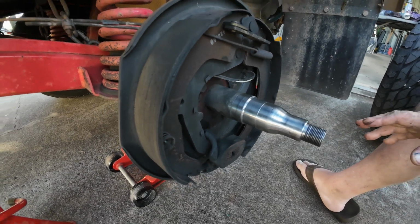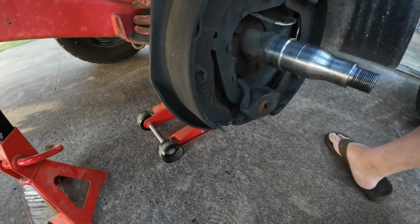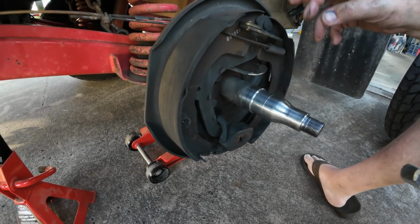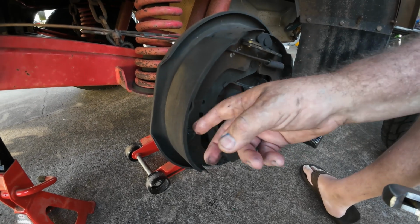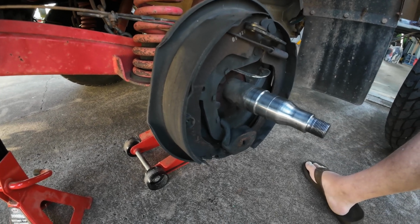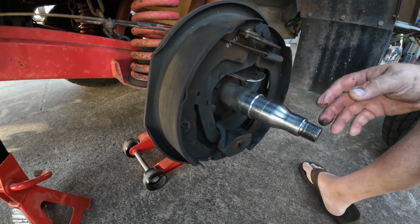Very, very easy to change, Phil, with your brake pads. They've got two little springs either side, so you just get some long nose pliers and pop those springs out, and just be careful when you release your brake pads, then slot your new ones back in, and then put your retainers back on. Fairly easy. But what I can see, mate, is everything looks pretty good.